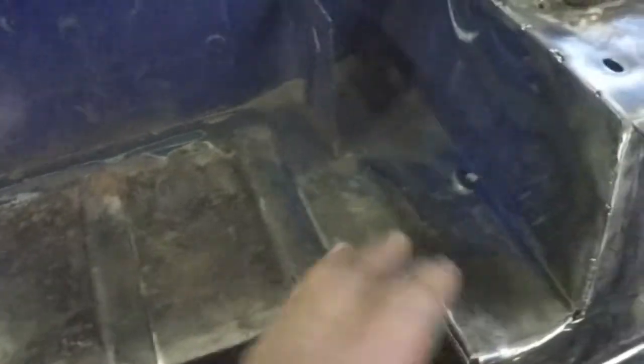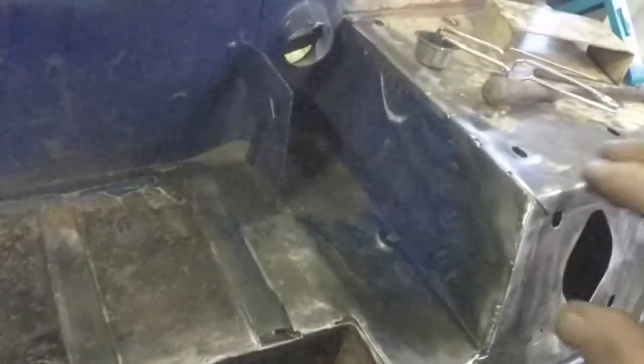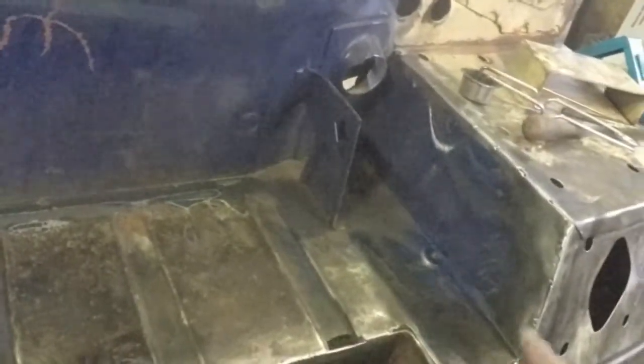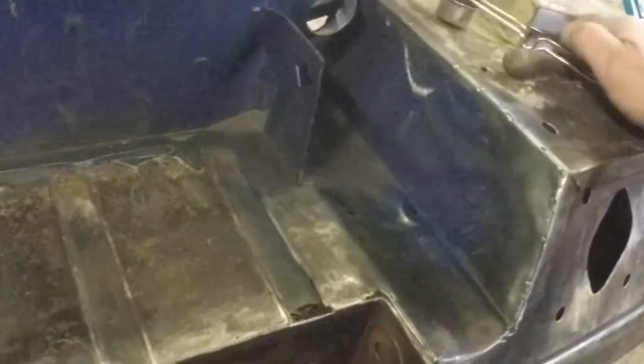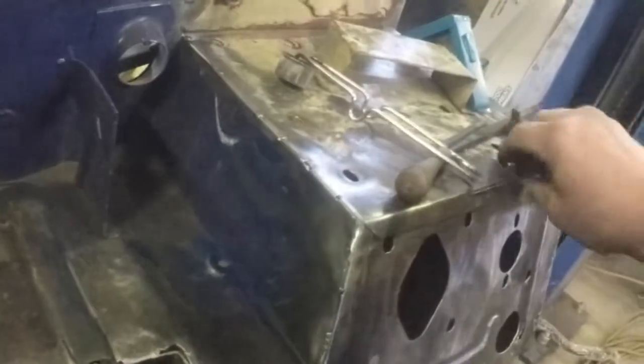So I had a donor car. And when I took it out of the donor car, what I do along this particular position right here is I take the old one out, fit the new one in, and then I go along and I actually use oxyacetylene, and I do a very fine heat weld. There's a piece of rod right there. Just a real fine heat weld.